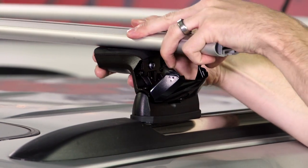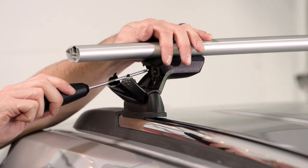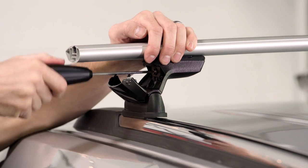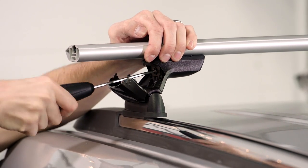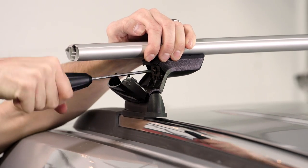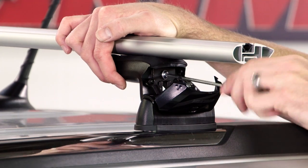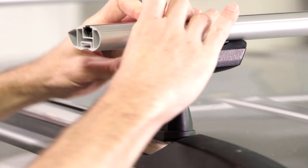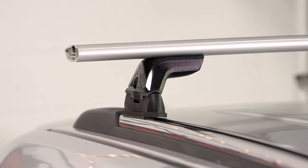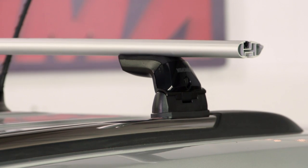Open and close the covers to check fit with the landing pad. Once they're placed correctly, put the torque tool here and level out the bars. Once engaged, it'll sound like a gas cap. Do three rotations of multiple clicks. Flip the cover to clamp the towers to the pads. Make sure they're on there. The car should rock. The rack should not.